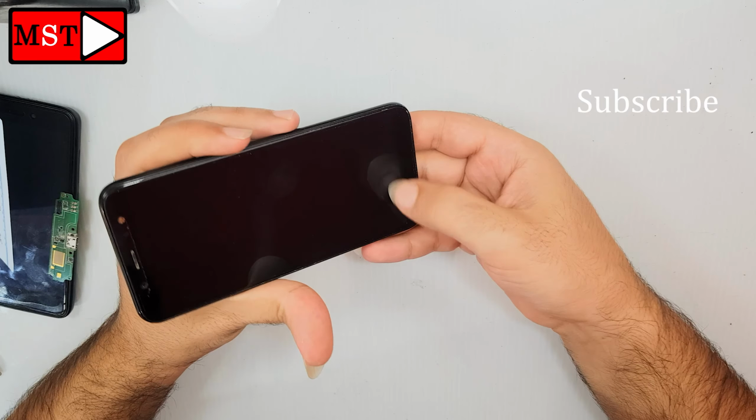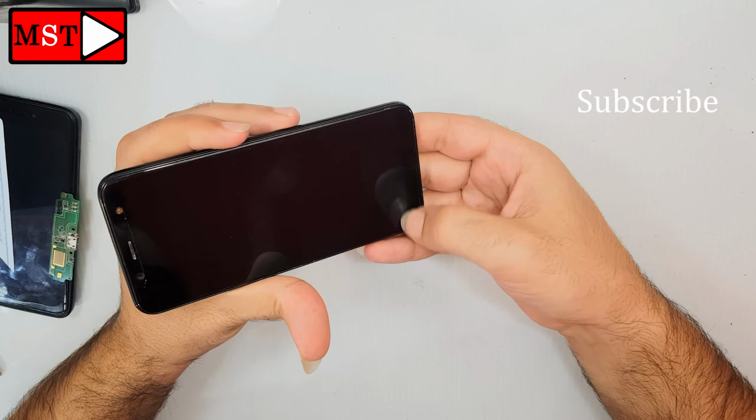J6 and A6 screen is the same screen, so you can buy one of them and replace it on your own. Start heating at 250 degrees. To note, this screen is cracked and damaged, so you don't need to go at 250 degrees. You can raise it a little more.